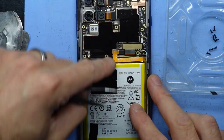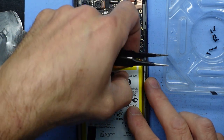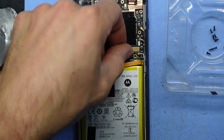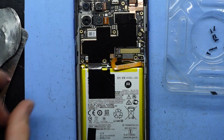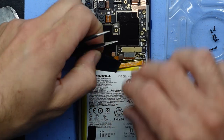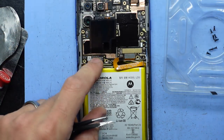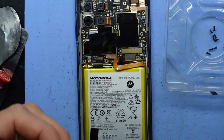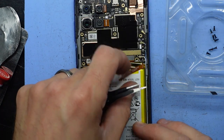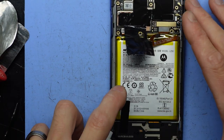Next up we want to disconnect the battery. I'm just going to use my nail to flick it up like so. Same with this other connection — if I compare over here, that must go to the screen. I'm assuming we have the screen connector. What you can do here before you fully remove the screen is to connect up the new replacement screen if you'd like to test it out prior to fully installing it, just in case — as phone screens seem to not quite have great overall quality control.